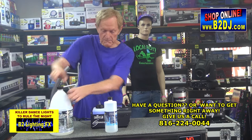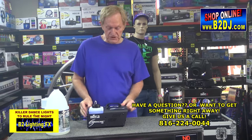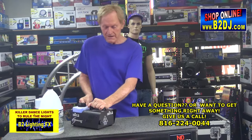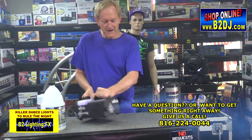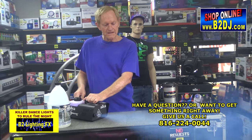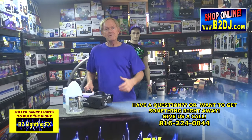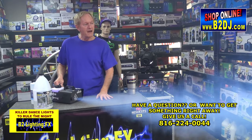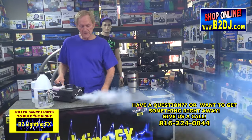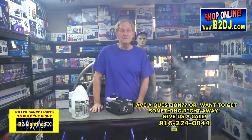It's still on and still warmed up too. Let's see how we did. We're getting the rest of the vinegar out of the machine. If you're going to see fog come out, make sure you get all that vinegar out because that can harm your machine. So keep pumping out some fog fluid for at least a couple of minutes. Make sure it's really thick and you've got the vinegar out of it.